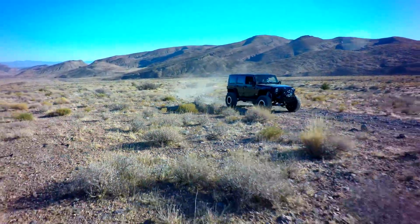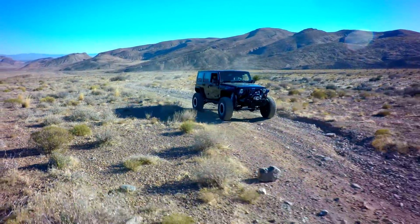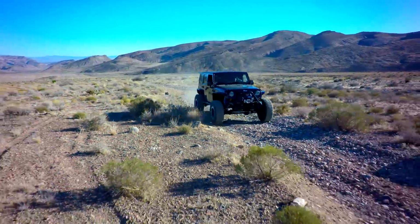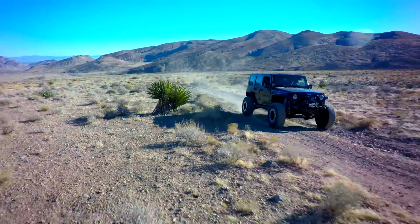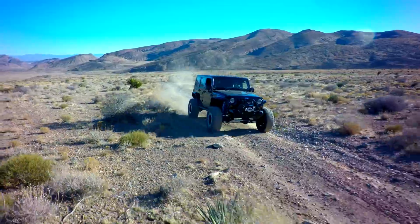And we spend a lot of time integrating the factory harness into this swap. This JK has double throwdown suspension from Evo on it. It's an early 07 JK, but you'll see that it has the same functionality as our newer builds do. The L9H engine we've talked about many times. It's essentially a truck version of the LS3 with VVT.